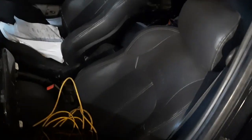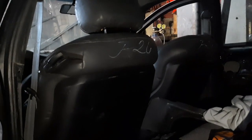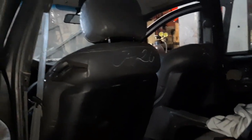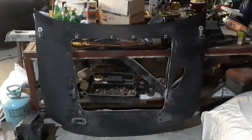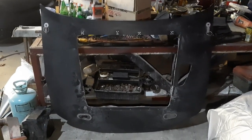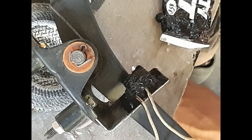These are the Tiburon seats — they're almost done being mounted in this video and they look pretty nice. This is the fiberglass hood; we had to cut a big chunk out of it because the intake manifold does not clear the hood. This is the micro switch we installed to activate the variable runners in that intake manifold — we mounted it into the throttle pedal so it activates at 75% throttle travel.